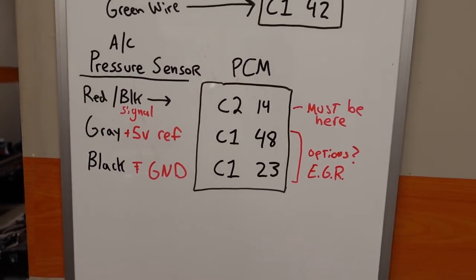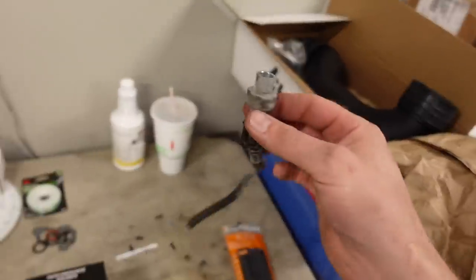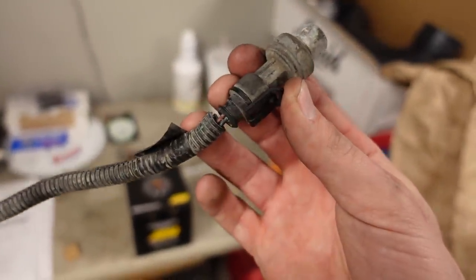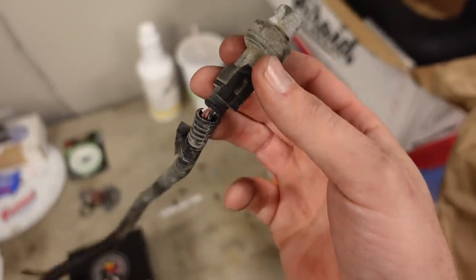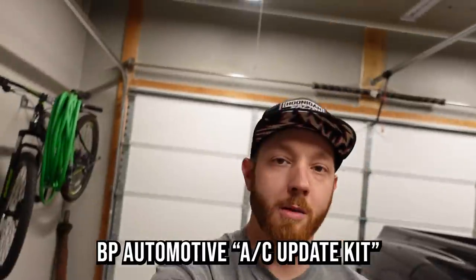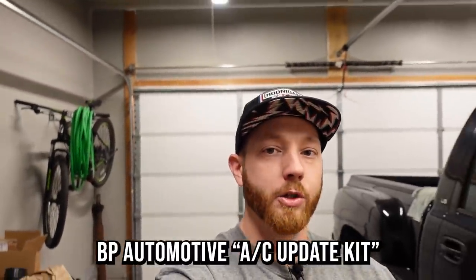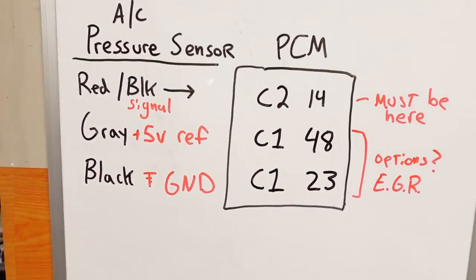And then the AC side of things, there's three wires that we're going to have to add that plug into an AC pressure sensor that you will need to buy and retrofit in. So this is one that Nick sent me from the junkyard, but I actually just found a harness this morning that comes with the sensor, the connector, and enough wire to get it all the way to the computer. I'll put the link down in the description, but basically you're just installing a sensor so the computer knows exactly how much pressure is in the AC system, and then it can turn on the fans and turn them off accordingly.